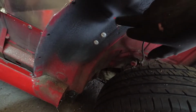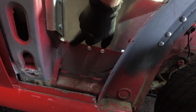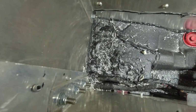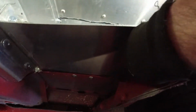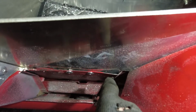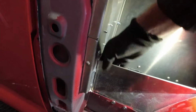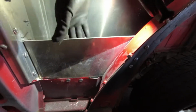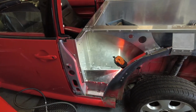And as you saw, I've got 3 rivets in here, and I've just got 2 in there, because if I try and put one there, if you look, I've got a lot of wiring down in the bottom corner there, so I don't want a chance of going through that wiring, so I'm not going to go into that bit. And the gap there is a bit too big to get another one in there, so I think 2 will be fine there, because the main strength is at this side here and to the wing here, so that's the main strength of it. So I'm happy with that. So what I'll do is I'll go do the other side now, and then that'll be those plates done.